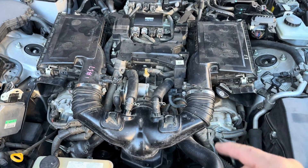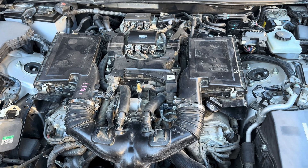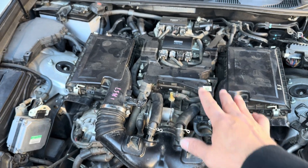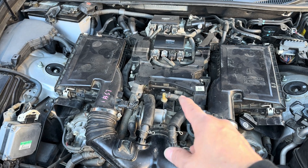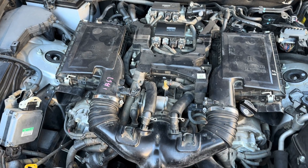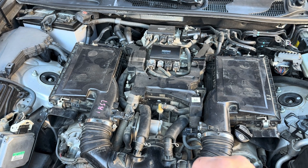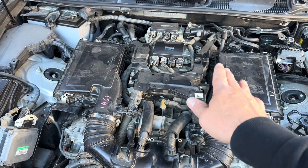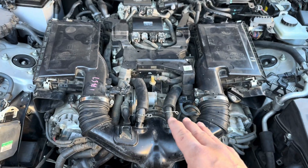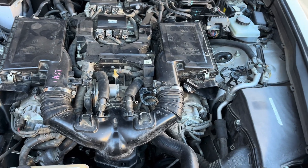After you do this, it's good to run the car hard — I took it out and did a couple hard launches. This car has a huge intake and most new cars have dual-length intakes with a butterfly valve, so when you spray this stuff in, it can collect in different parts. Running it hard a few times will suck whatever residual is in there through the engine, because otherwise it's going to run rough for a bit. With that said, we're going to let her cool down, pull her back apart, pull the spark plug, and take a look at the results.